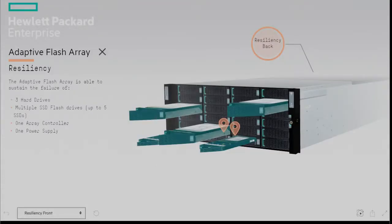This leads me on to resilience, where hard drives within the array utilise triple parity RAID. This provides 3 parity drives, which means the array can simultaneously lose 3 hard drives and your data is still intact. This is a non-configurable feature which delivers simplistic array management without impacting performance.